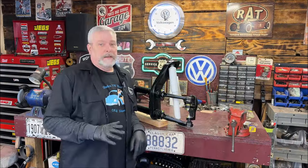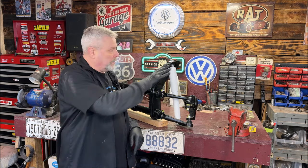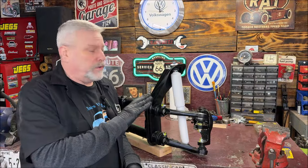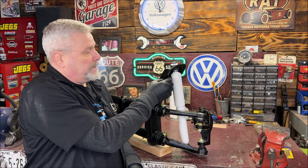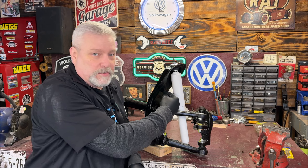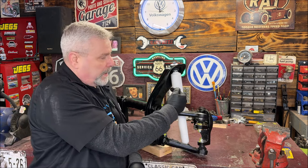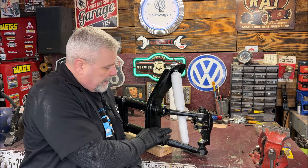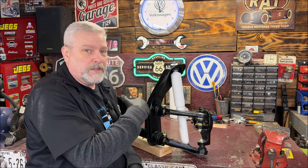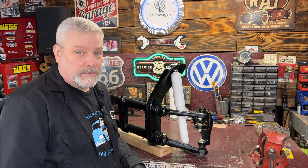Okay, let's start. Okay, much better camera angle now, so I can bring the camera in closer to what I'm doing here. Now, like I said, you pick where you want to put your grease fittings. Maybe some of you will put it on the front right here. I just figured going in from this direction, you can come right in through the wheel well, with the wheel cut, and go ahead and shoot grease in there. We want to keep this filled up so that we don't form moisture in there. I think this is excellent. I really do. So let's get started on this right now.